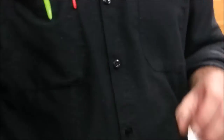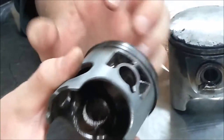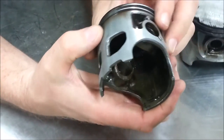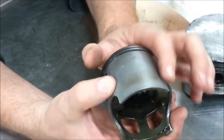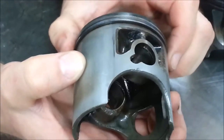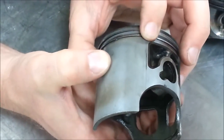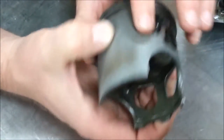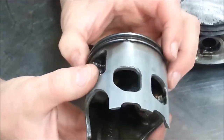That's the blaster piston. This piston is actually pretty good — this is what I'd like to have to show that it's just got minimal blow-by. We don't see the carbon tracking all the way down the piston. You can still see some of the machining marks in it — so it's just a good use piston. We don't see any scoring or scratching on it. Now look at this right here — do you see where there's this one smear over here? Not to where I can feel it with my fingernail, but that's evidence of a cold seizure. Did somebody get on it a little too hard too soon? When it's going down the sides there, that's what we've got going on. So this visually looks like a decent piston other than it could use rings.